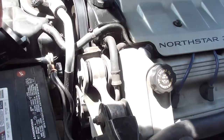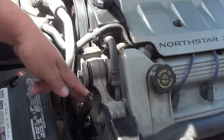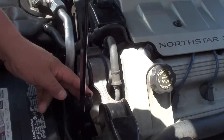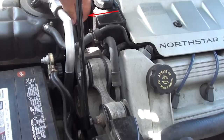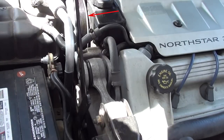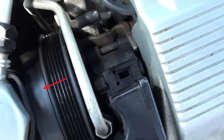You can see the tool here — I just slide it in. It comes in two pieces. I'm sticking the half-inch part in, then I put the other bar in to give it a little more leverage, and I turn it clockwise towards the front of the engine. Once I pull forward, you can see my fingers pushing the top of the serpentine belt off the pulley of the power steering pump. Remember, we're only taking the serpentine belt off the power steering pump pulley. As you can see, the serpentine belt is now off to the side of the power steering pulley.